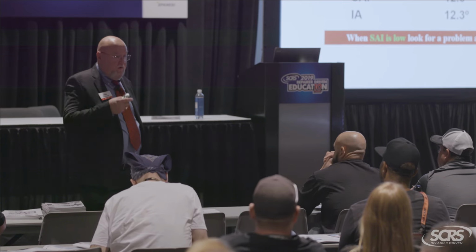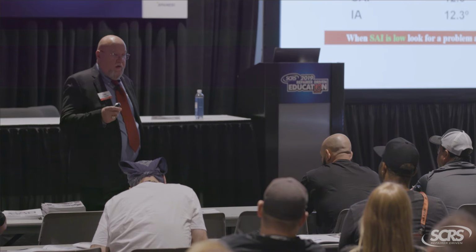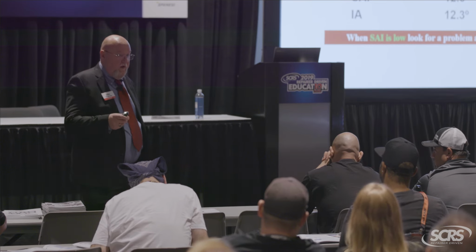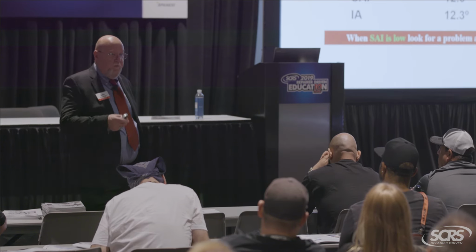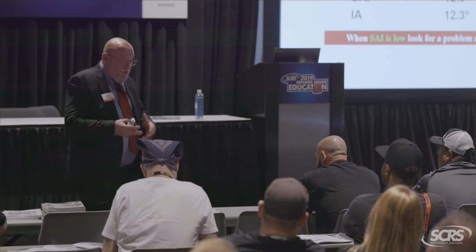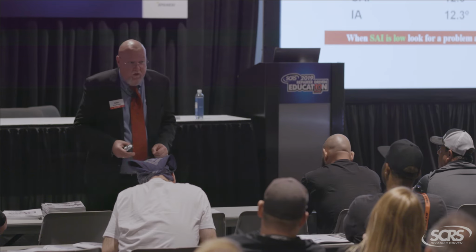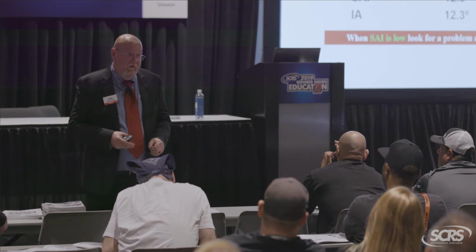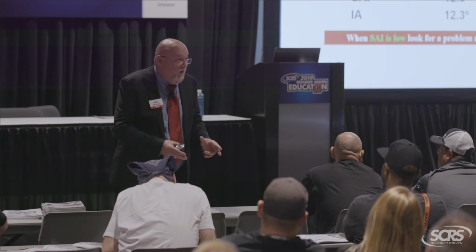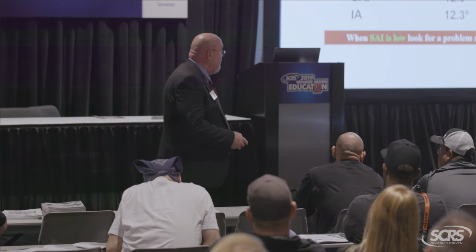Now, you remember what I said, I measure cars all day long. Typically, cars that need cam bolts have a higher IA number, right? See, that's what I'm saying. It goes back to the iCar thing I said in the beginning. If they want to say it's a half of a degree, they'll tell you to put a strut in something that may have just needed a mere adjustment or a correction kit, okay? But if that included angle goes up over that 1.5 degree number, you've got bent parts, and you need to chase that down. Never, ever, ever, that was 3 evers, right? Put correction parts in to make up for a bent component, because that's going to lead to a lot more drama than you need, okay?